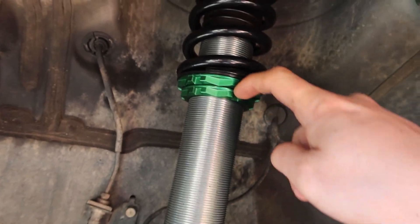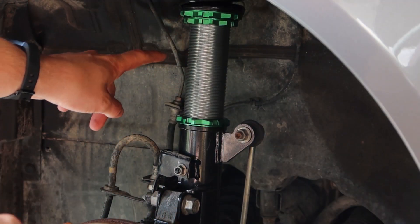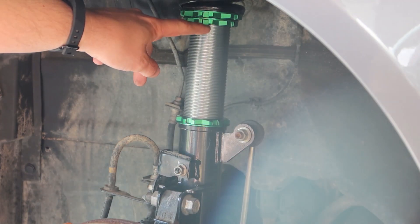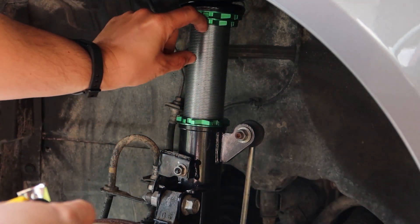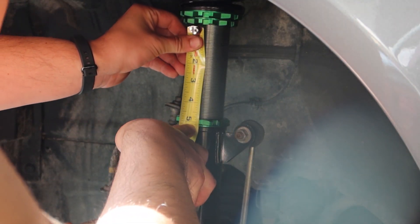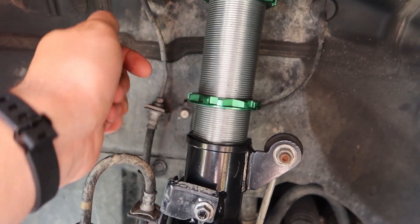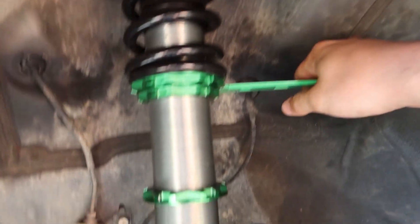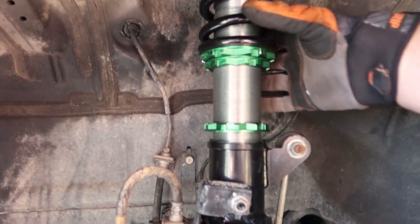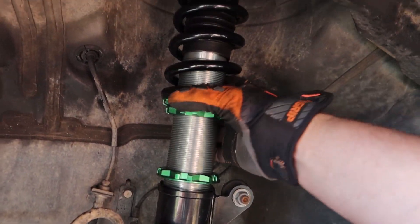You're just gonna loosen the top locking collar. You'll also want to have a ruler and measure the threads - I go from the bottom of the top collar to the top of the lower section. On the other side I'm at about an inch gap, so we're gonna go ahead and try to reflect that on this side. Currently we're at about 4.7, so since we're going up a good ways I'm just gonna bring it all the way up. As you do this you'll notice that everything moves - that's okay, it's just all the threads feeding down into the boot. If you have gloves you can use two hands to rotate; it can be a little faster than the wrench. That looks like about an inch.